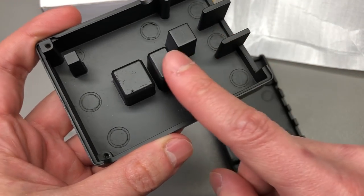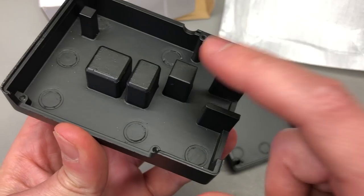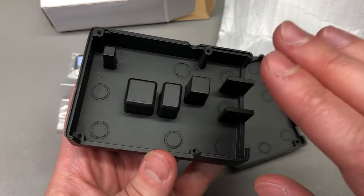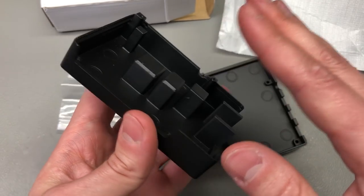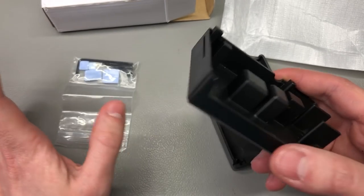This one is designed specifically for the Pi 4, so the aluminium islands that are supposed to contact the chips have exactly the right size, shape, and height. It's important to search for the advertised model of your Pi to get the correct heatsink for a perfect fit and optimal cooling. They also include silicone pads and the required hardware to assemble the case.